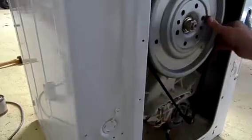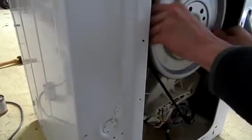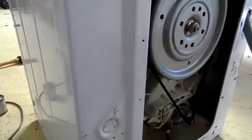Jumper screws, so it's not on the rusty, the outer two that are rusty, but that's all together. Next step will be to just cable tie that up there and fit this in. Stuff the terminals back in, make sure they're all secure, tie that, and put the door boot seal in. Should be ready for a spin.